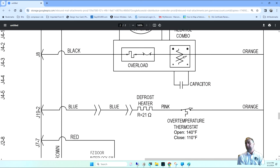If you went to a refrigerator with a 47-degree thermostat and replaced it with a different brand 47-degree thermostat, that's probably not going to be a problem. But if you go from a 140-degree and put in a 47-degree, and something happens with that circuit, you open yourself up to possible scrutiny. Be very careful if something says 140 and you change it to a totally different temperature setting.